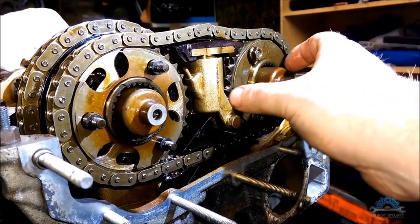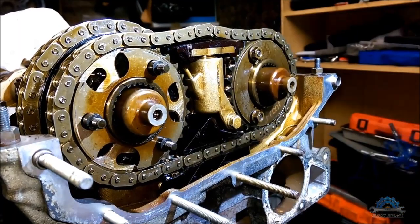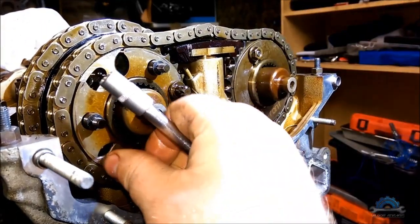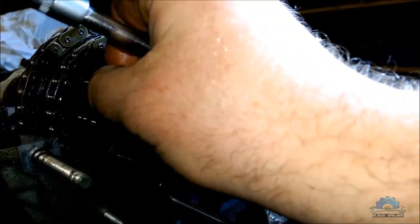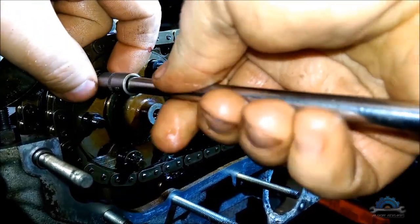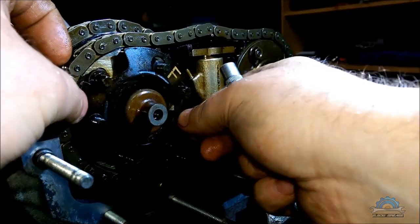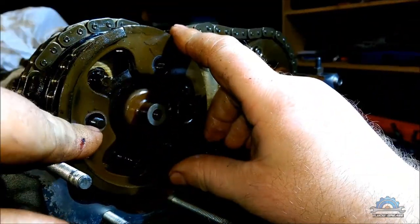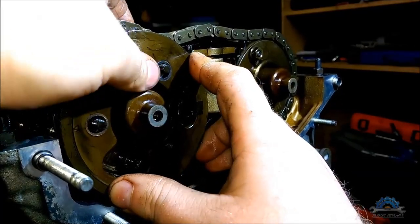Okay, so I installed one of the tension plates, which is on the intake side. It says front and 3 nuts. Now 3 Torx bolts. Not too tight, just finger tight, because that's gonna be torqued down later when you're gonna set up the timing. And then the spring plate and the timing wheel with the arrow facing the same position, that edge of the cylinder head, same as the first wheel we did.